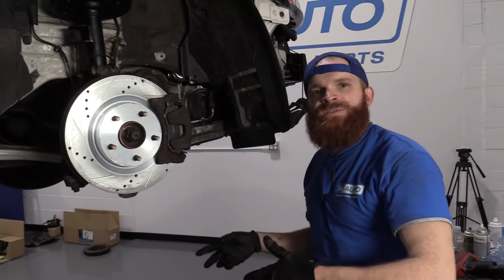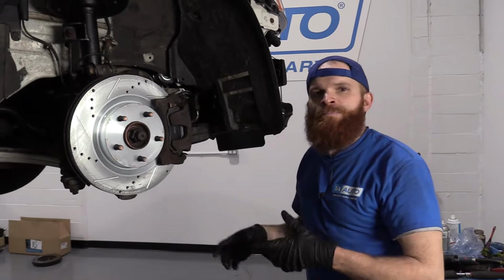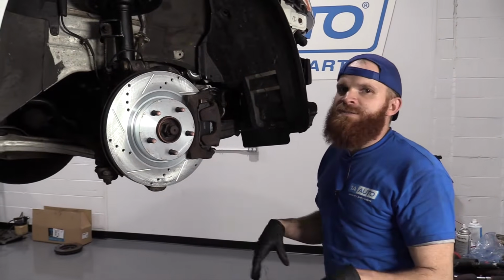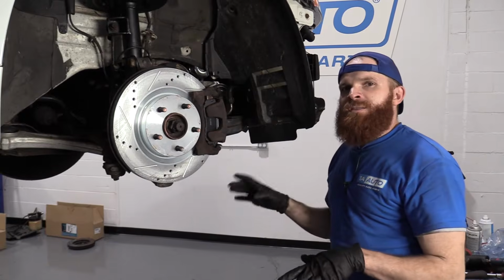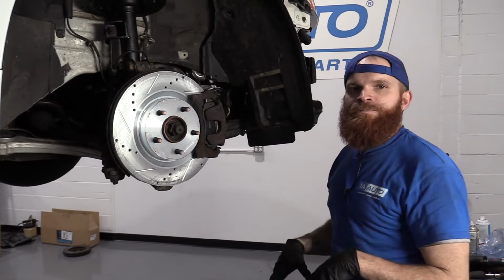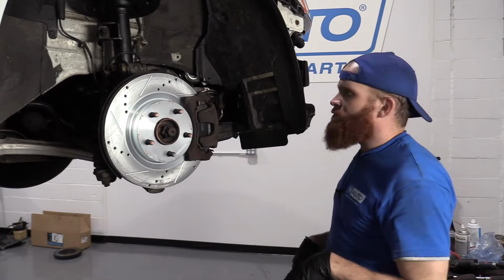If you run it for 2 minutes, well, it's been off a tooth all this time, you're gonna ruin your brand new belt. So we'll go 10, maybe 20 seconds. You just wanna start it up, let it run for a little bit. We know that the belt does all its looping around all the things, and then we'll turn it off, and then we'll check it, right?